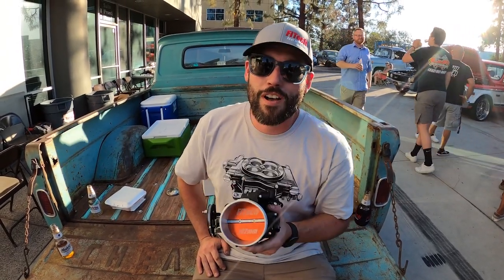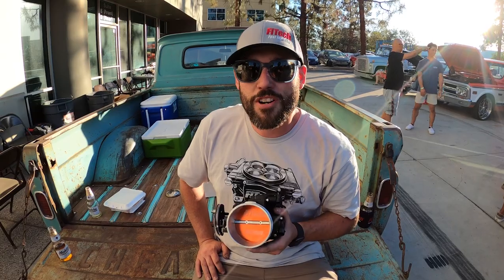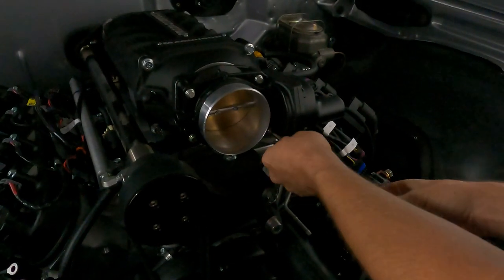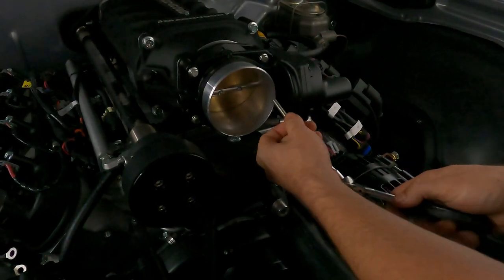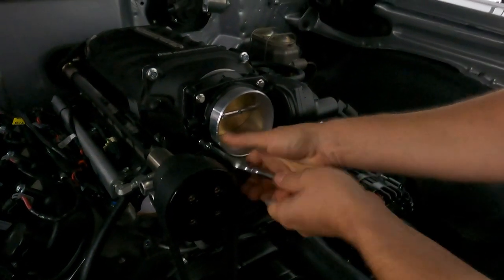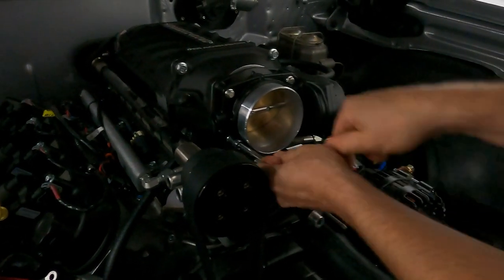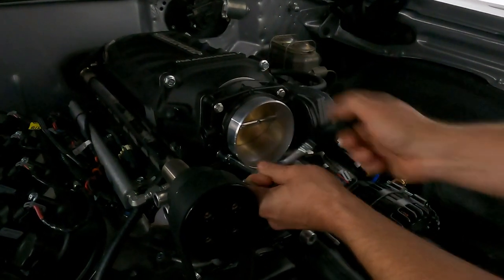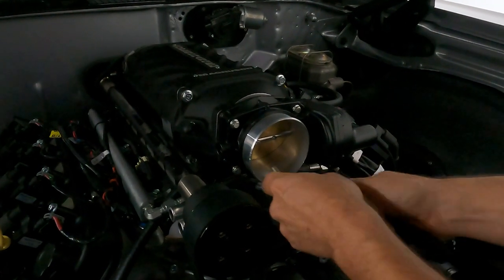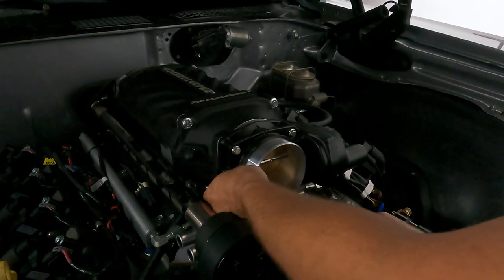Not only that, we also got you all your fuel lines. We got a Force fuel delivery system to boost that fuel pressure up for you, to make sure you got constant fuel pressure to make that horsepower. And this is a stock one we're taking off. Yep. This is the one the engine came with. A good GM drive-by-wire unit, but we're going over to drive-by-cable on this for the FiTech engine management system. Gotcha. And is it usually a good thing to swap this out when we're doing a whole FiTech ECU and all that stuff? Yeah, with FiTech it's required, I believe. FiTech guys can correct me if I'm wrong, but I believe it's required for the FiTech LS.